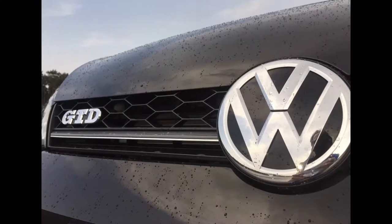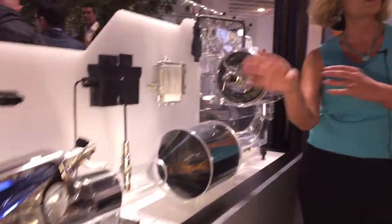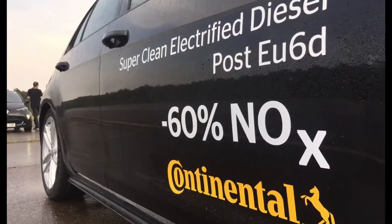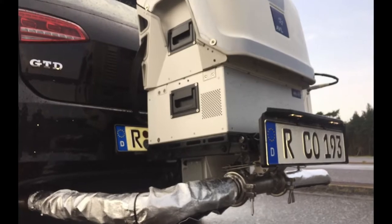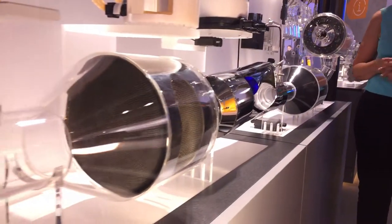Matthias Mueller last night said they are going to bring diesel back, but there will not be a diesel vehicle without the SCR. And that really is part of what you need to make this super-clean electrified diesel. You can achieve very high efficiencies when the temperature of all the catalysts is in a certain range — starting a little below 200°C — where you can achieve efficiencies of up to 95%. That means 95% of emissions, particularly NOx, will be reduced. What we experienced in our Quantitech show was very low real-driving NOx emissions — the record was 9 milligrams.